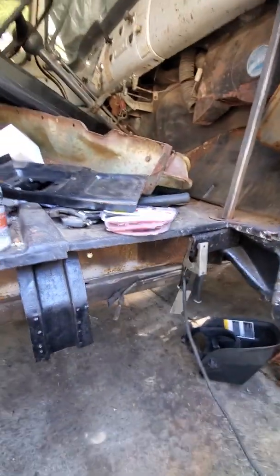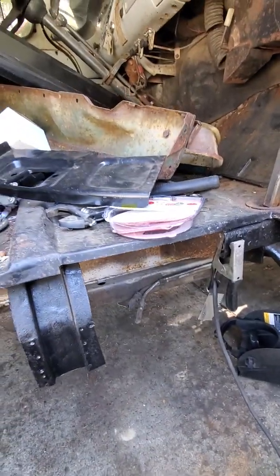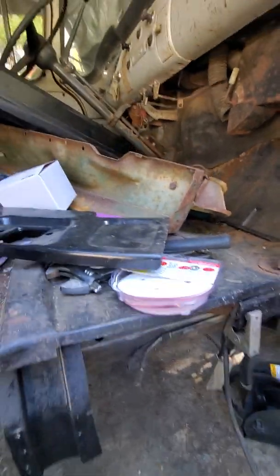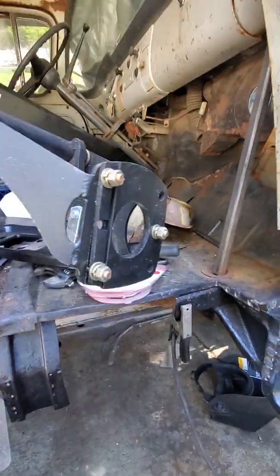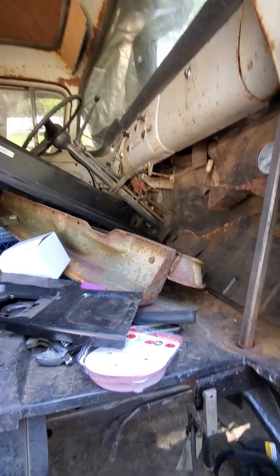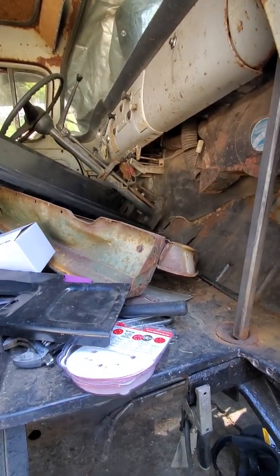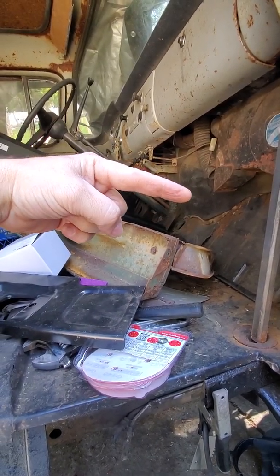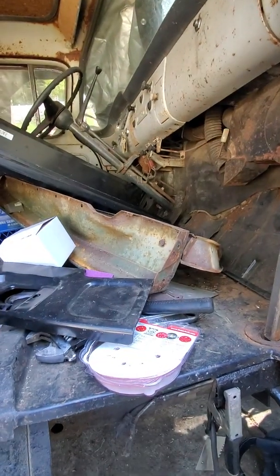So I've got to get the body off of the cab. Before I can get the body off, I need to put in my brake pedal. So I've got a swing set to go through the firewall. And then I've got to get my steering column lined up, because my steering column, you see where it is? It goes down like it was going into the factory steering column. I'm going to tip that up so the steering column will be more pointed towards the driver, and I have an aftermarket column.